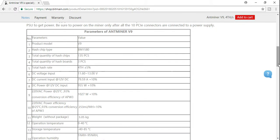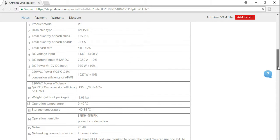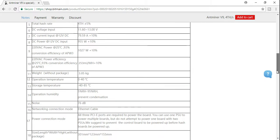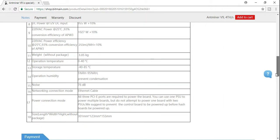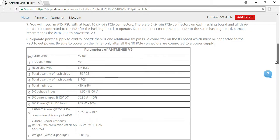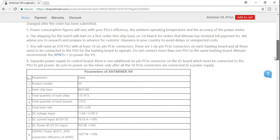This unit draws around 1,000 watts and about 4 terahash a second, give or take 5%. You can get all the specs right from the website. It uses the same power supply as before, the APW3++, which can be used on your traditional 120 volts here in the U.S.A.